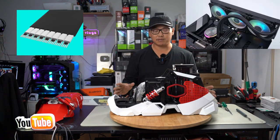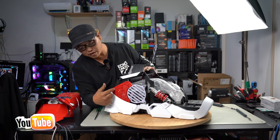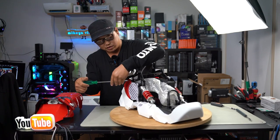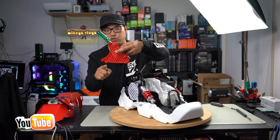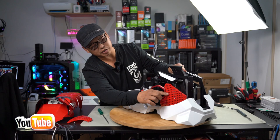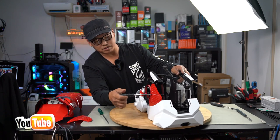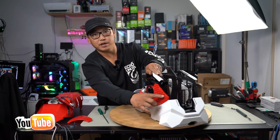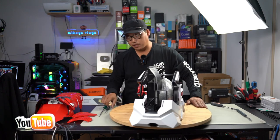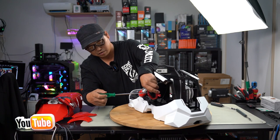On either side you've got two red panels. To remove the first side there are two screws — one there and one more right at the top. Once the screws are out, just lift it straight up; it has two securing tabs on the bottom. On the other side there's another screw and two more smaller screws inside that secure the logo — you'll need a smaller screwdriver for those. Remove those, then the screw at the very back, and lift it out just like the other side. Remove the Cooler Master logo by undoing one screw — it flopped down straight away once loosened.